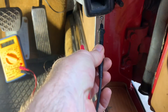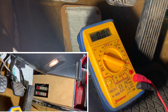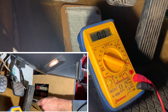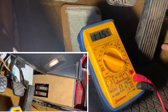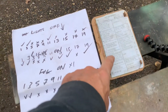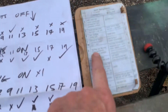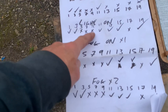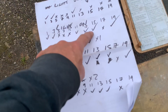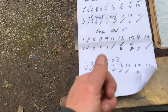To test the power across a fuse, hold the black terminal on this earthed screw and take the red terminal and touch it on the bottom of fuse number nine. There is no voltage across fuse number nine. Fuse number 15 has power when we turn the lights on. After testing each fuse with lights off, lights on, fog light pulled once, and pulled twice: fuse nine has no power in any state. Fuse 15 always has power as soon as the lights are on. This tells me that switch is either faulty or not wired correctly.